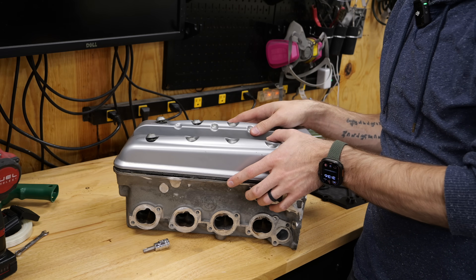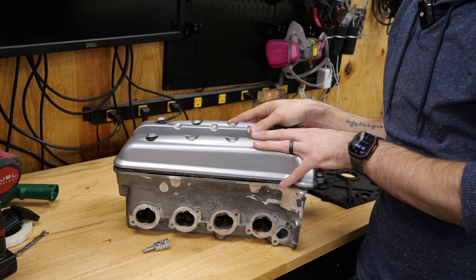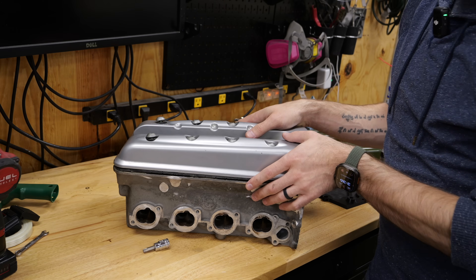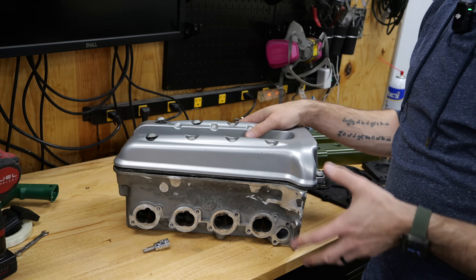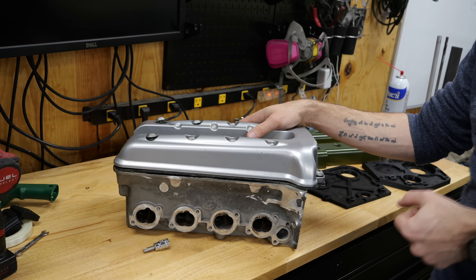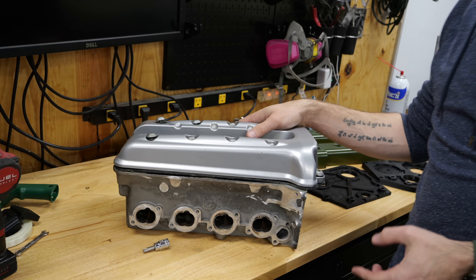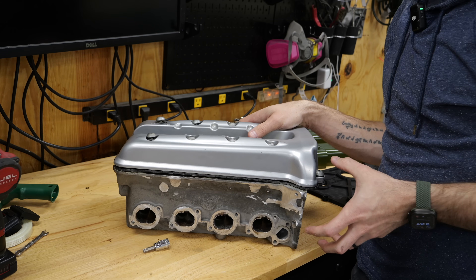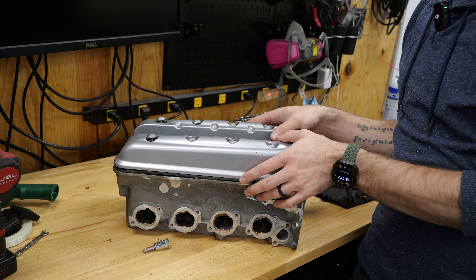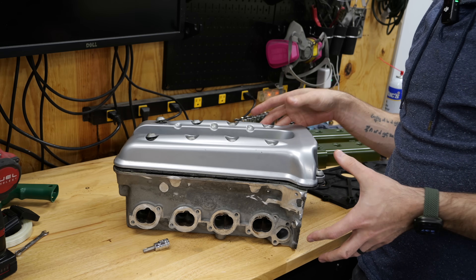Many people take these BMW cylinder heads — there are eight-valve versions and these 16-valve versions, and they come with different cams. They have become extremely popular, especially with people who want a really high-torque, high-punch 1275. You can put four carburetors on the front, or four individual throttle bodies and do a really nice fuel injection setup. This is going to give you easily in the 150 to 160 horsepower range, just by virtue of being crossflow and building up the engine the right way.